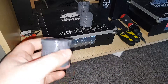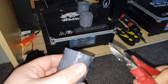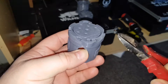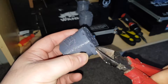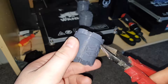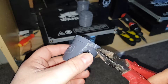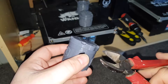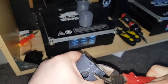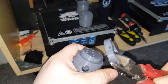It's difficult to do it one handed. This is the only pliers good for this particular one. Fits perfectly. Let's get some focus. So the way that I do it — I know that there's a very thin gap. It's not really a gap. It's just that the plastic joins here much weaker than it does, say, here, as part of the solid part. So I know that if I apply enough pressure to this, it's going to pop right off. I'm just levering it this way until it pops off like that.